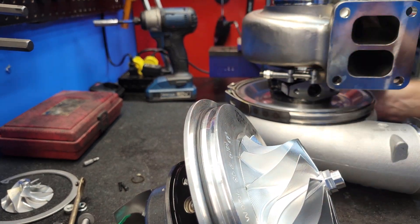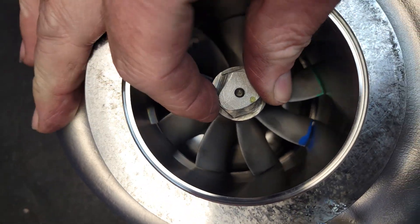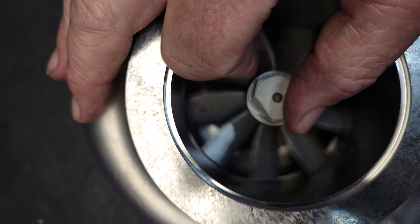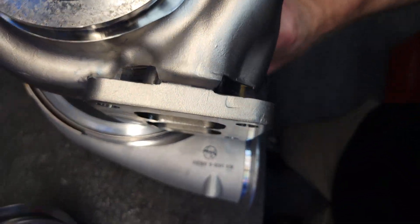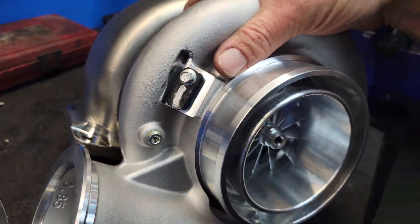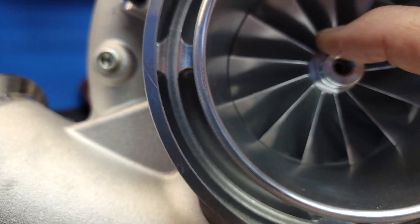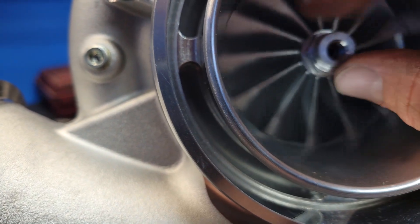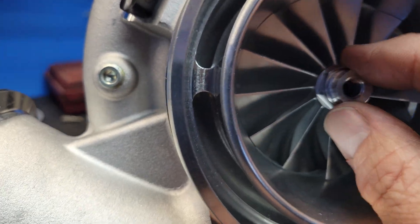Once you get the housing on, if it's on the workbench it's easy — just look and see if the wheel is centered in the housing. Push and pull on it. Even though this is a ball-bearing turbo, it still has shaft play in it. Make sure you don't have any wheel contact. If it's on the car, do the same thing. It's worth taking the downpipe off and looking at it if you've had the housing off for any reason or the cartridge out of it. When you pull this guy down, you're keeping about — in some cases — as tight as nine thousandths of an inch. I've set some of our race turbos up at seven and eight thousandths. That's each side, so 14 thousandths total. You have no room for error.